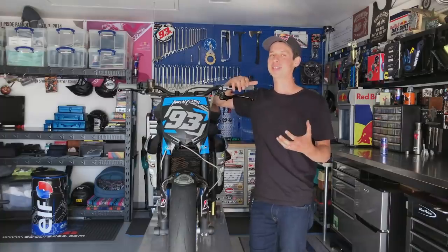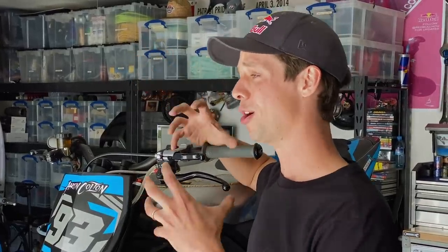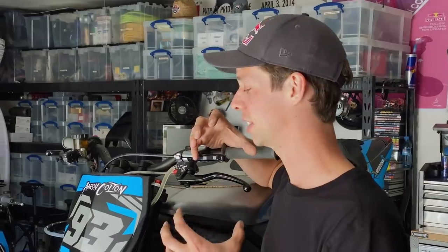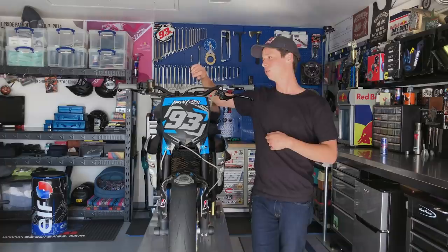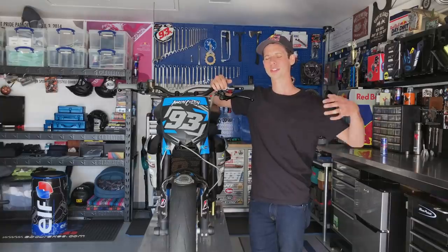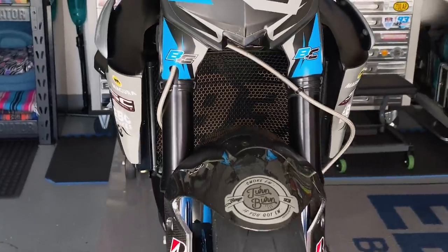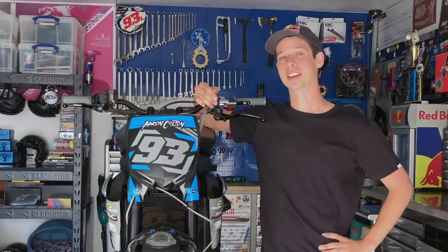A freestyle bike lives on the rev limiter, and that creates a lot of heat. And when I'm riding at an area like Circuit of the Americas or Indy Motor Speedway, no issue. There's plenty of room in between to cool the thing down and it runs great. When I get put in a small, compact demo area, that's when I really run into issues. So I run Evans coolant accompanied with the OEM fan, which runs on the thermostat, and then an additional fan that runs on the key. What that does is it allows me to head start on cooling the motorcycle down before I reach the boiling point, to keep the overall system at a cooler, more relaxed state before I have to park the thing.